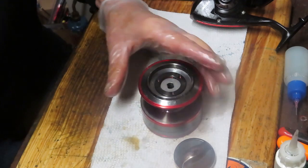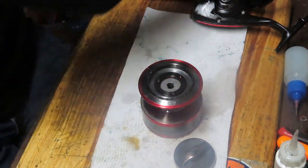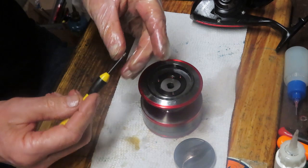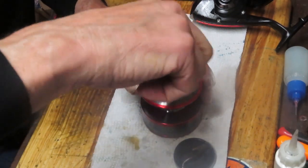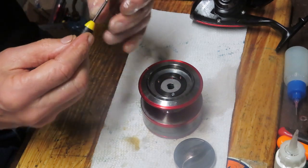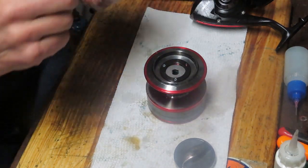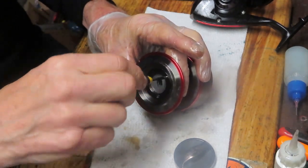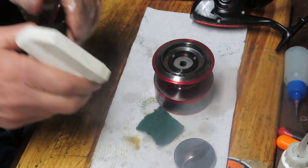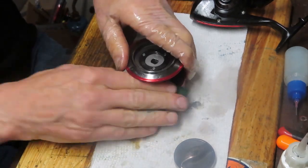I'm going to go back to my micro driver for these very small screws. They've been sitting in my parts tray awaiting reinstall. I'm going to put a little dab of grease on the screw tip to act as glue to help me get them started. Then we'll do a little cosmetic cleanup and give it a test to see how we did.